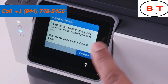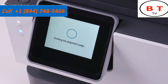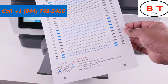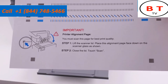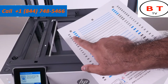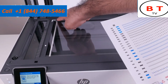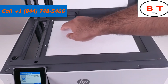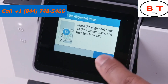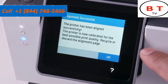On screen there's a new message saying we're ready to align the print head — it uses one sheet of paper. Hit Continue and it prints the alignment page. Once printing is complete, place the alignment page on the scan bed in the exact orientation shown in the diagram: open the scan bed, place the page face down, align the top-left corner of the page with the mark on the scan bed, then close the scan bed. Hit the scan option on screen and it scans the alignment page. The next screen confirms the alignment was successful — hit OK.